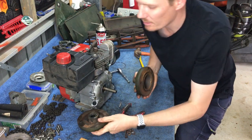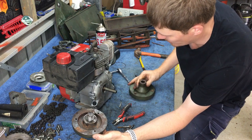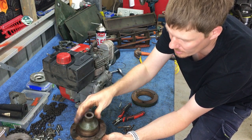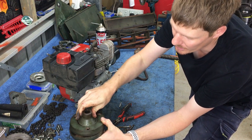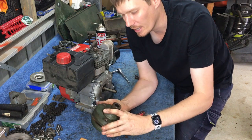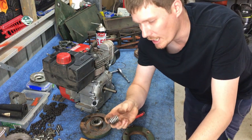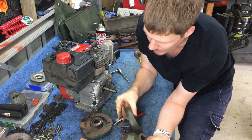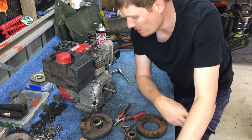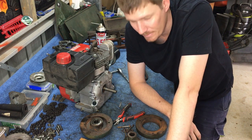For the purpose of this video, this is how the clutch goes together: clutch, bearing, clutch spring, clutch cone, and outer case — so spring, clutch cone, then the outer case goes on top. That's basically how your clutch works. When you engage your clutch fork, it pushes the clutch cone in which squishes and compresses the spring inside the clutch cone. This clutch would be going in the bin, but that's how I'd go about removing a stuck clutch and disassembling a clutch. Thanks for watching.